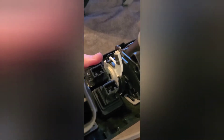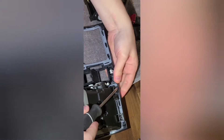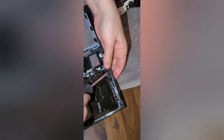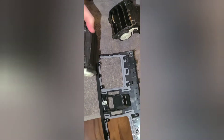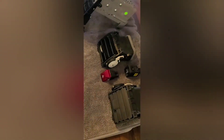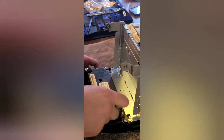For the two buttons, squeeze them with a decent amount of pressure and they should come out fairly straightforward. Get a flathead screwdriver and work from the top down — pry them up, position and separate from the top, pull it back. Do the same thing on the other one: pry that up and pull straight back. Once you have the vents removed, go ahead and transfer them over to the iDoing unit. Same thing with the HVAC controls — just screw it in, real simple. The vents just pop right back in; very straightforward.